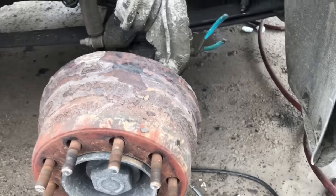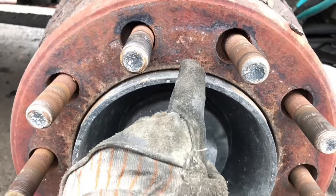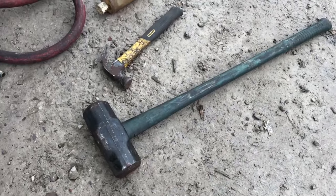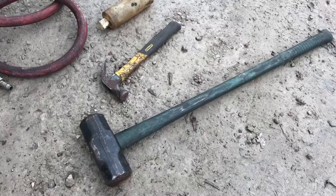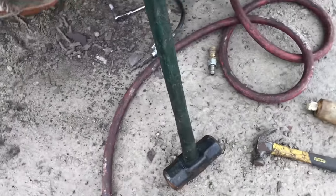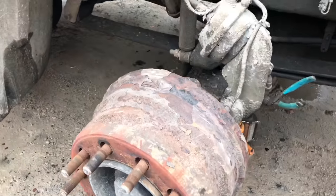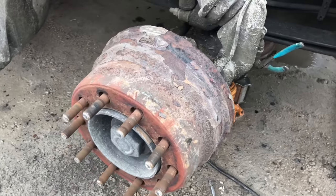The other side was a lot easier to hit with this small hammer. If it doesn't come off — it's rare when the drum sticks to the hub — and you can't do it with the small one, I do recommend having a bigger hammer. You can get one pretty cheap at Menards; you don't necessarily need that big hundred-dollar one from a heavy diesel truck parts store. You can get a nice 12 to 16-pound sledgehammer at your local hardware store. Just hit it at the lip — don't warp your drum, especially if you're reusing it.